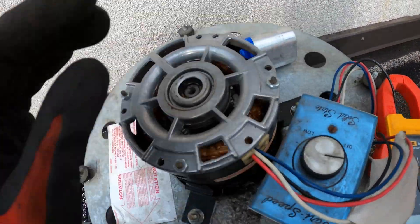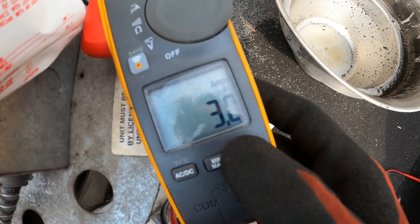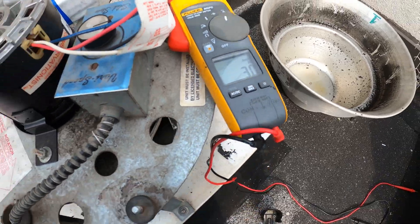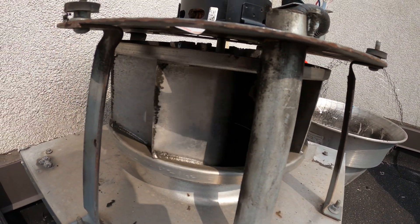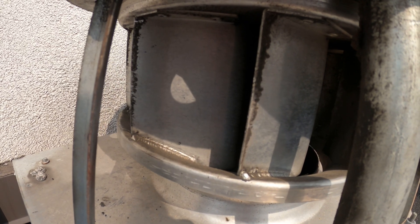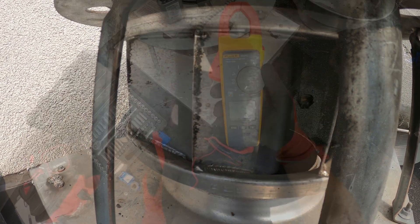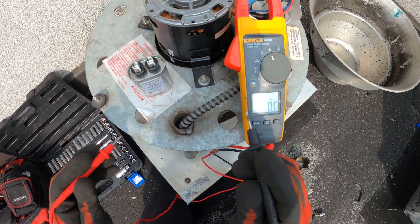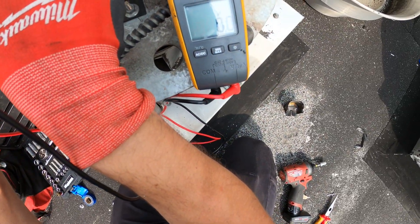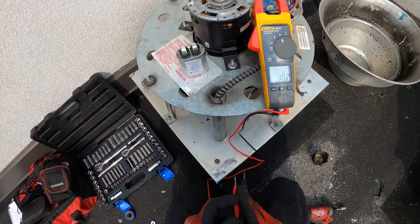Let's start it. Motor's still humming. It's done its damage already. Look, it's trying to spin — slowly trying to spin. It did its damage already. Turn the power off, discharge the cap, set our meter to microfarads. Let's double check that we got our 10 microfarads. We got 10.2 — it's not that.